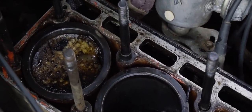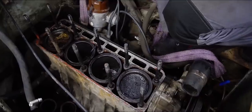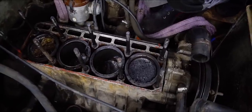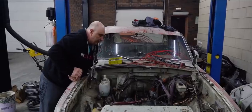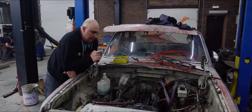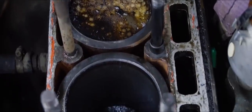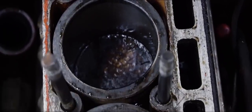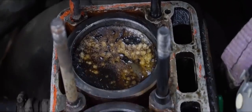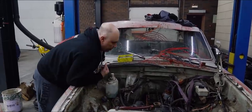After removing the cylinder head, we witness a lovely picture indeed. Those pistons are roasted — and all of them differently. The one in cylinder number one looks like a bowl. Number two isn't that bad. In number three you've got another bowl — I think it was cylinder three where the spark plug took a hit. As for number four, that one is also fried. Cylinders number one and four have burned right down to the lower ring, in one spot.